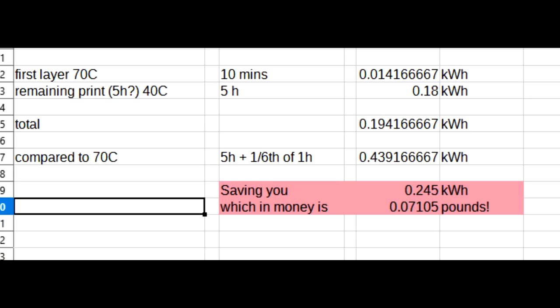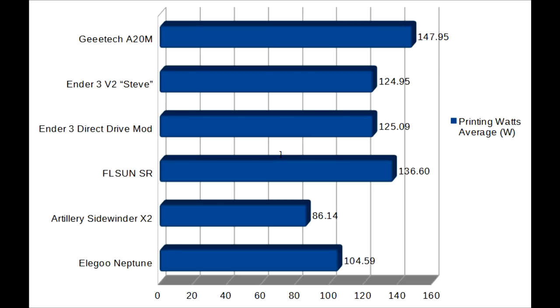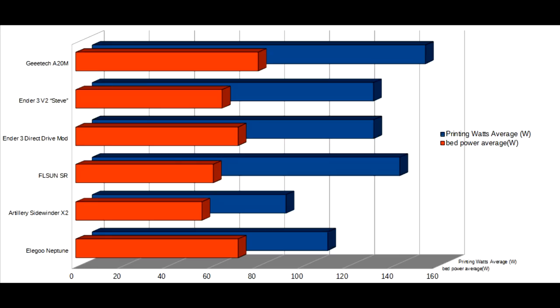With all the results we have so far we can actually start to get a bit closer to actually comparing like for like with these printers. If I show you this chart where I've taken the benchy energy and divided it by the time taken, you can get raw watts averaged over a benchy print. I am aware that there will be an initial heat-up penalty when you first start the printers, but in the results I took half-hour versus one-hour heat times and didn't find the difference to be notable enough. I can also overlay the bed power usage — it's interesting how this is about half the total power for most printers. The FL Sun though is a bit of a weird one; I think it might just be delta stuff — they work significantly differently from bedslingers.